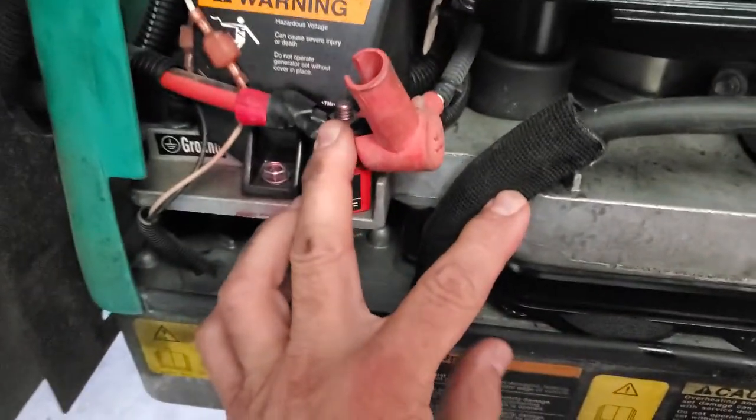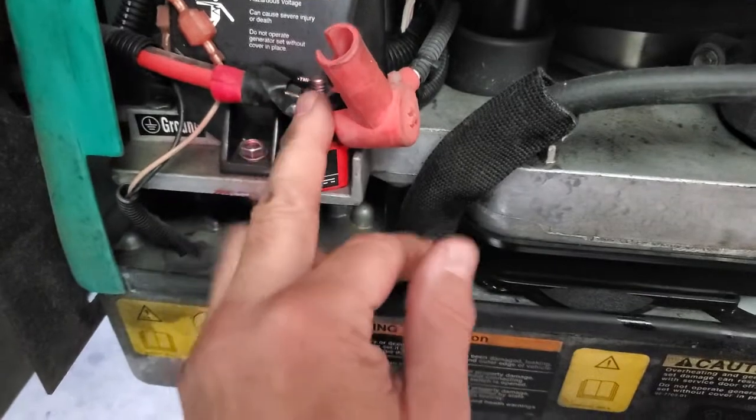So let's say you've got a little bit of a problem. You go from the positive terminal here to ground with your multimeter and you crank it - you don't want to see below 10 volts there. But let's say you go back to the batteries and they're up like 11.5, but you've got only 10 volts on that bolt where it says positive on the generator - you have a problem on your positive feed side from your batteries to your generator. That's how important some of this testing is. So I'm letting it all hang out today - hope you had a good time with this video.